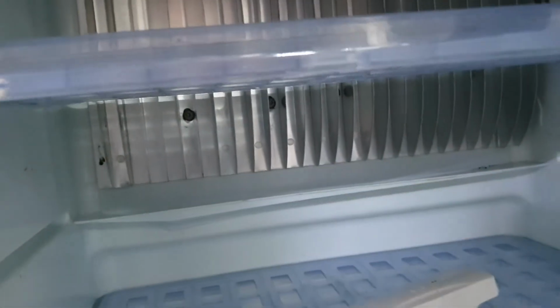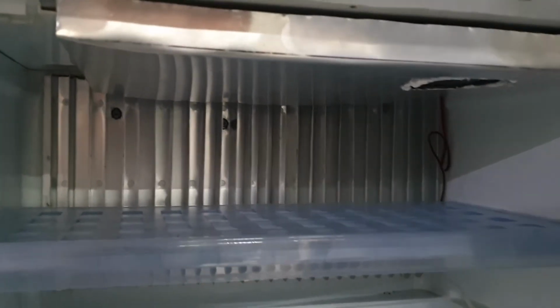This creates a waterfall of air, very slow waterfall of air across these fins, and that drops down and circulates cold air in the fridge, and that actually does a really good job. It is beneficial. You do not want 2 big 80 millimeter fans in here attached to that heatsink, which I've seen some kits do. Totally unnecessary. You don't want to move huge volumes there. You just want enough to stir the air up and perhaps get a bit better equal distribution in the fridge.